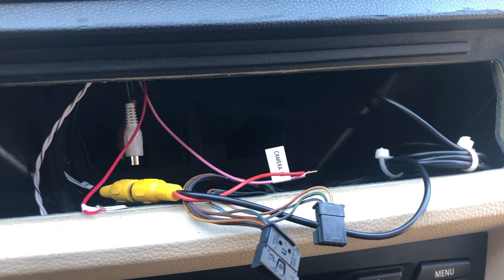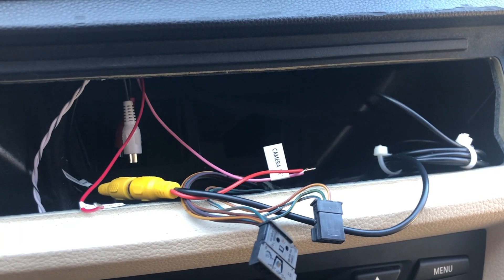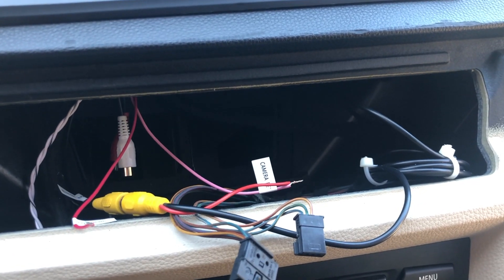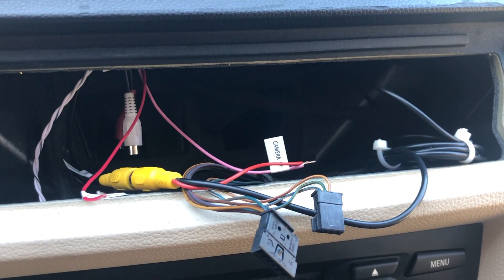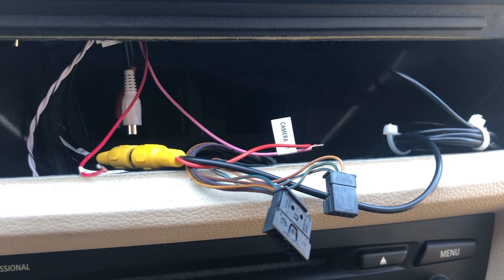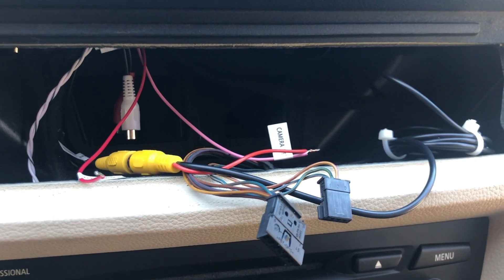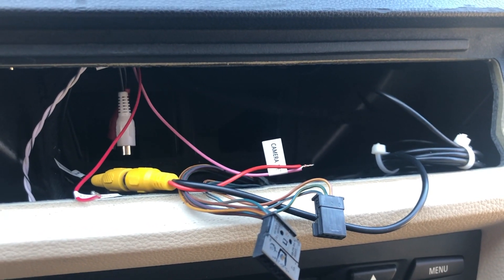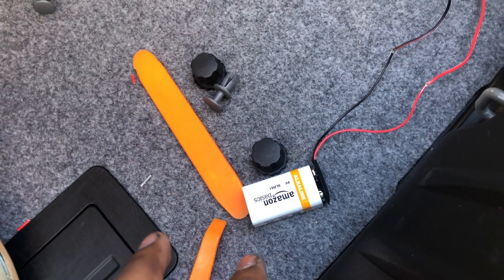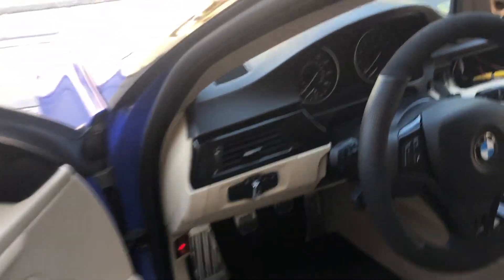With the manual, it's a bit different in the sense that there's no TCU, so the car can't necessarily directly tell what's going on. At least now I know that in order to get this camera to work, there needs to be some sort of trigger and a proper power input. To test it out, I hooked up a 9-volt battery to these leads, which essentially tells the car it's in reverse, so the camera should be on permanently when I turn the car on.